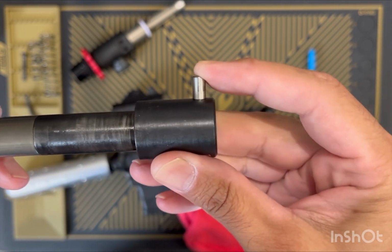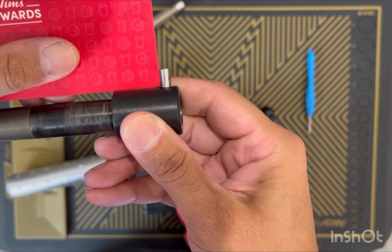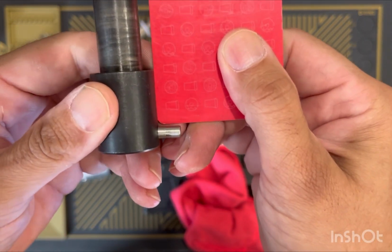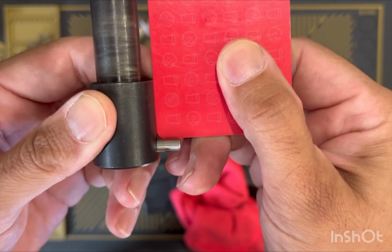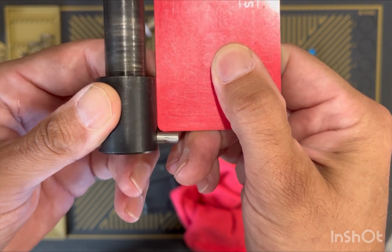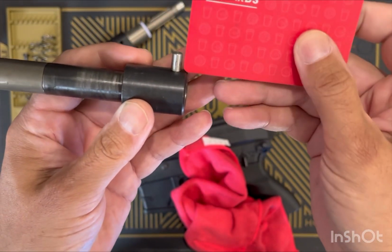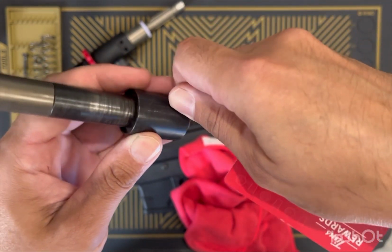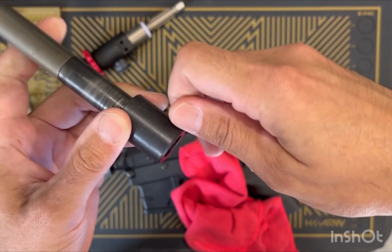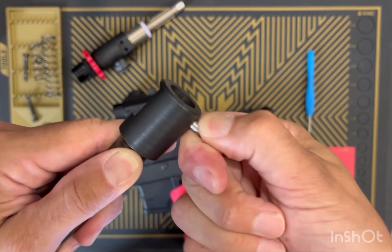my pin has taken a little damage. And I'm probably gonna be able to show it. So I'll pull the card flat on the, it's gonna be tough to show you guys. I might have to do it like this. Flat on your bolt. It's barely detectable to probably the camera. But this pin is laid back a little bit. So what you're looking for is you want this pin perpendicular to the bolt, and here's the other test. If it's been bent, it's probably loose, and this is loose.